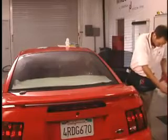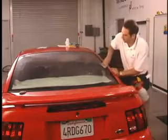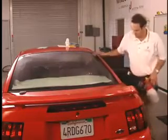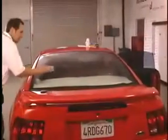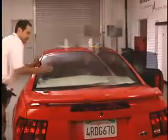Next, moisten a paper towel with mounting solution and wipe a single horizontal line across the middle of the window. Then wipe a line up and down each side of the window, making a large H. These points of moisture will act as the anchor for the film as you roll it across the window. At this point, it's important to move fast before the moisture evaporates.